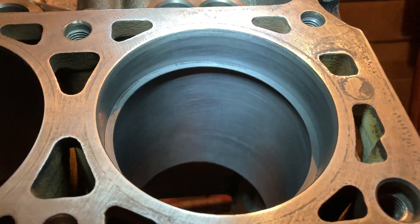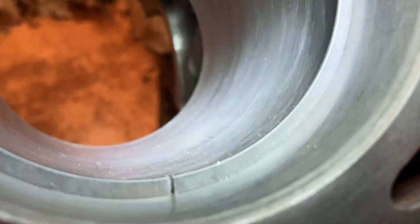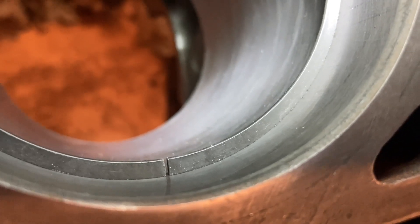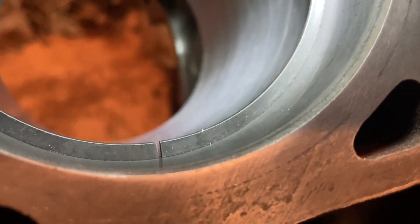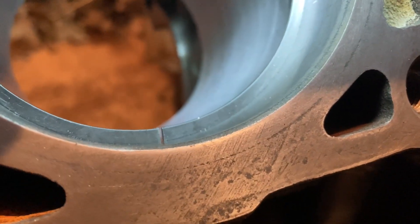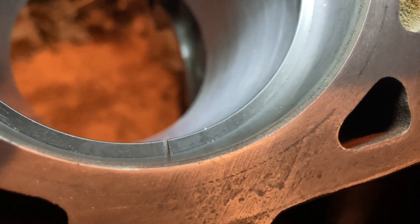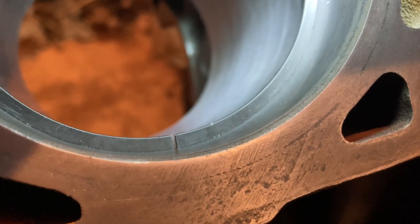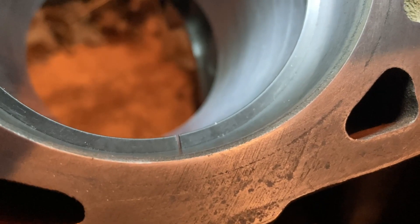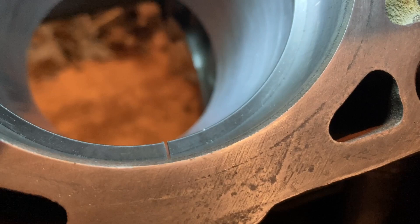I'm now at the point where I'm starting to file down my piston rings. This is my first one — I've got to get it to about 22 thou; right now it's sitting at about 20 thou. So I've got to take it back out, file it some more, and get it to 22-23 thou. Because I'm running boost on this engine, you've got to have a little more gap in your ring so that as heat gets in there it has room to expand. On my last engine I had it set at 21.